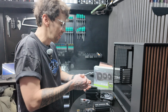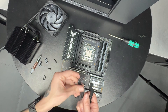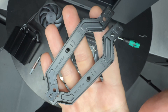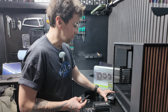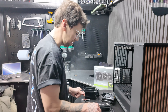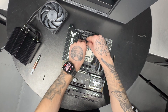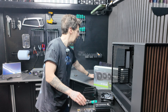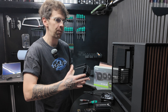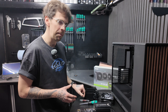You're going to start with what's called the risers. This essentially suspends the CPU cooler over the top so that the contact point will just be the bit that's supposed to cool it. Luckily for this one, there are instruction manuals you can follow, and they've been very kind as to put specific labels on it so you know where it's supposed to be pointing. This is a Noctua CPU fan cooler. You'll start to put on the standoffs to raise the cooler, then same again on the other side, and then when you've got the bracket on, it's time to figure out how the cooler is going to make contact with the CPU.